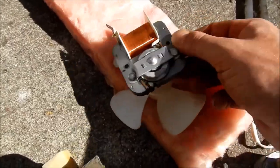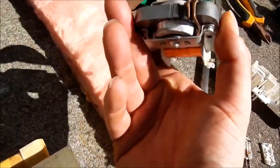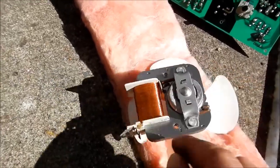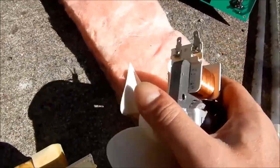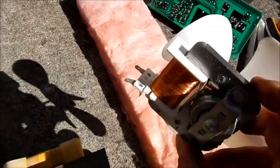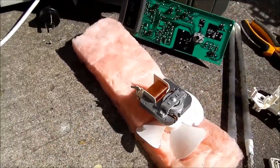I've also got the fan, and I love the bobbins of these for Tesla coils. You just take the main parts out with the screws - these ones are rivets so it's a drill-apart job. Then you grab a heavy pair of pliers or a hammer and you can break this large piece of laminate away, sometimes a couple of layers at a time. Then the core comes out on its own separate little laminated bar, which I often keep in case I want to use them for inductors - you can slip the magnetic part back in the core for an adjustable inductor.